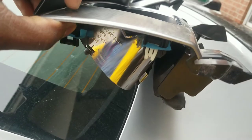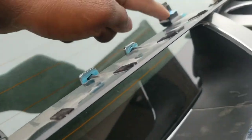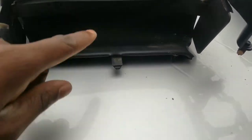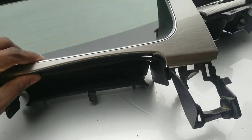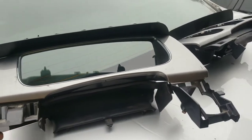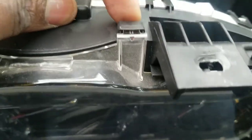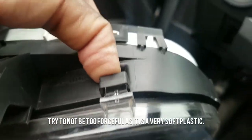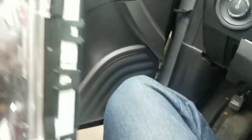You also have two connectors on the side, two on top, and two on the other side — so six total as well. The only difference is just getting this out. Don't forget to pry it out and you should be golden. So going back to showing you what we're doing on the 2010 SHO: push it down and then push it out. Basically when you do that, as you can see, it's poking out — but you've got to be very careful, otherwise you're going to break the tab.